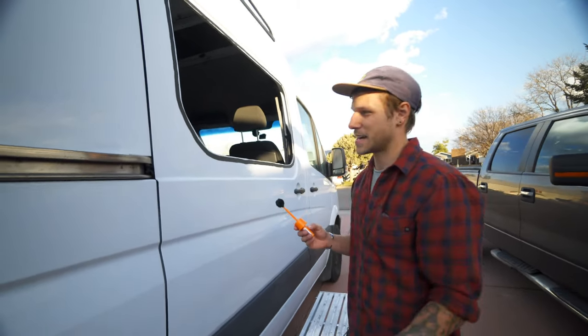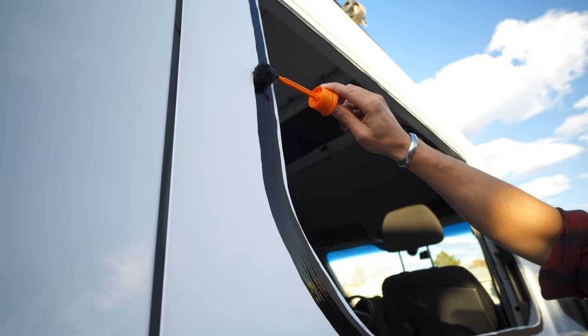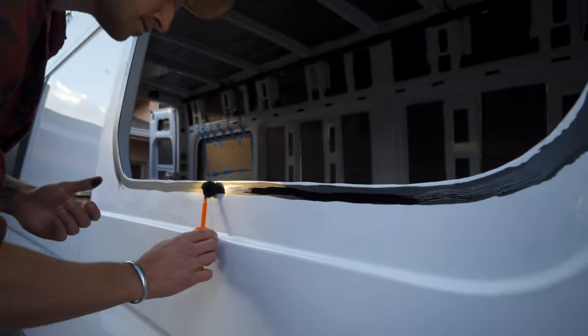The first thing you do is shake it for about 60 seconds until you can hear the bead inside. With the dauber loaded up with primer, Ben went ahead and applied a solid line all the way around the perimeter of the opening — all in one pass. You're not going to need to go and load it back up; just one dip will get you around the entire opening. The reason they don't want you to go back in with that same dauber is because you might have some dirt or debris from wiping it on the van and then put it back in the container, which can affect the primer. One thing that did happen while I was doing it is the camera died, so you won't see me do this step. I did go back and thicken my line with a second pass so you could see the process of applying the primer to your van.